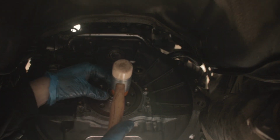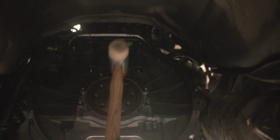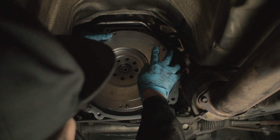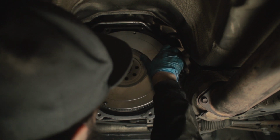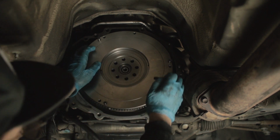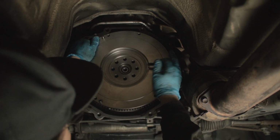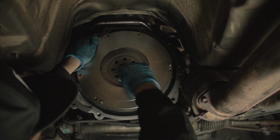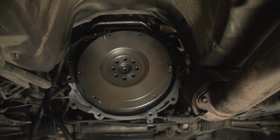First up, the spigot bearing. Then I'm gonna put on the flywheel. This is from Conceptua, I'm not entirely sure how you would pronounce it. It's basically a stock flywheel, stock weight, nothing too fancy. I don't like lightening the flywheel for drifting, simply because of the clutch kicks. You want some momentum coming back. Okay, some Loctite on there.